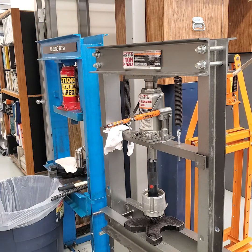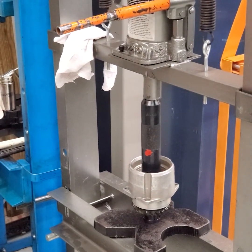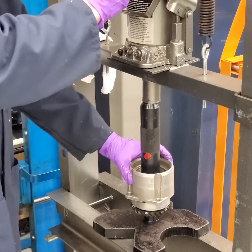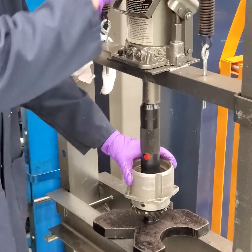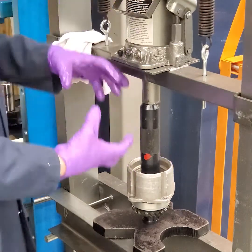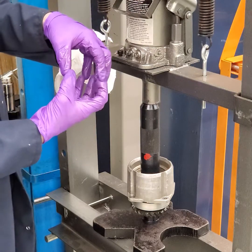Let me zoom in so you can see this better. What we're going to do is rotate this, press it down, and keep rocking it. We're getting close — the bearing still spins nice and free. Now it's going to get tight because the inner races of those bearings are touching that pretension sleeve — the crush sleeve — and now I have to use the press to start to distort that. The crush sleeve is going to bow out.